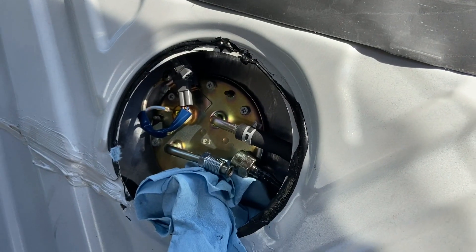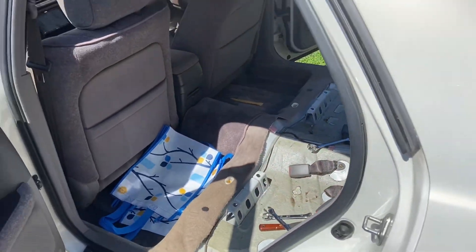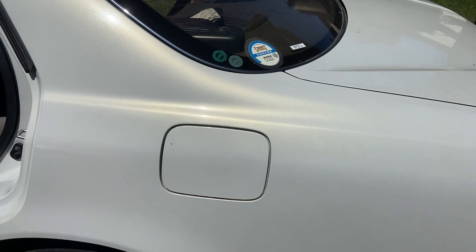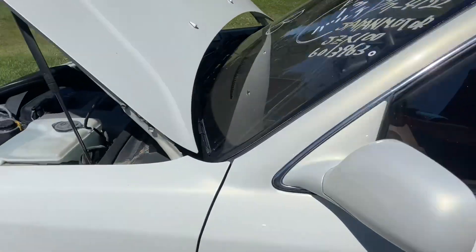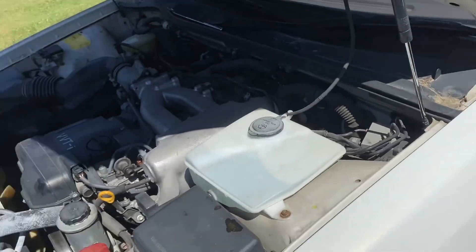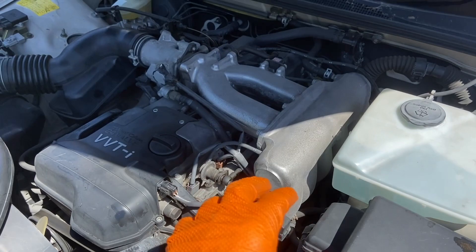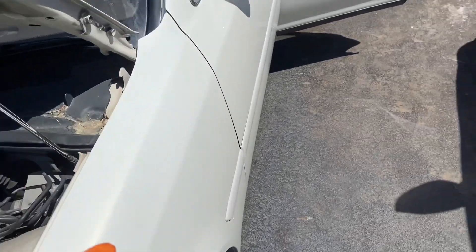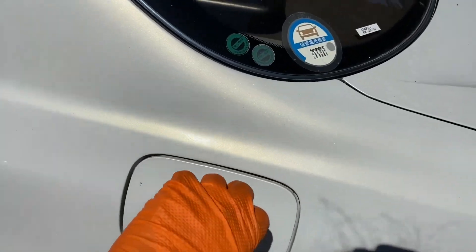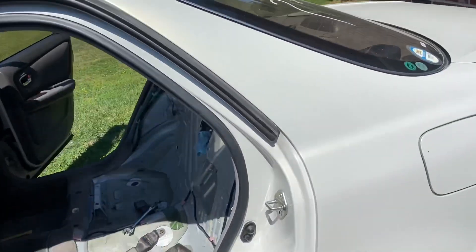This access panel is just held in with RTV. This is a really big thing for you that have JDM cars — when you go to put gas in it, there's positive pressure coming out when you take your gas cap off. So when I started taking this 14-millimeter bolt off of the fuel line right here, I certainly didn't have pressure. I was ready for it, thinking if the fuel pump is actually good there's going to be crazy pressure — there was not, which helps tell me I'm right. But there was a constant gentle flow, more than pressure from a fuel pump, just coming and coming. So I thought, open the gas tank, relieve the pressure, went back over there, cracked it loose, and no more fuel.